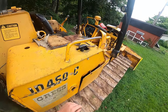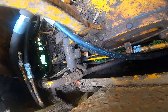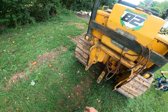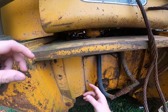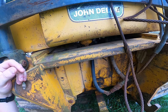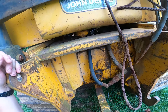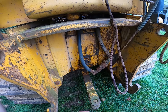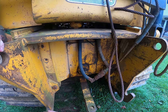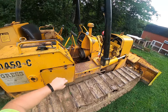Which leads to my next question: how to get the tank off so it can be cleaned and serviced if I have to do that. I'm just not real sure. Once I get some time, that's going to be my next job. I think this has to come off the bottom and the fuel will just come out — and it's completely full of diesel, so I'll have to get some clean cans and probably just drain it first. It's going to be a mess, but I don't know what else to do. Besides the air in the lines, everything else seems to work perfect, so if anybody has any ideas, leave comments down below.